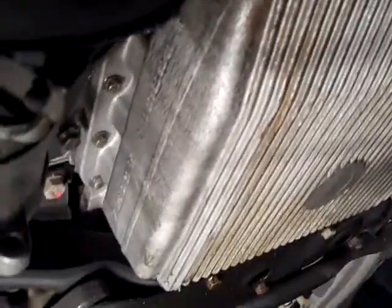So now we're going to go underneath the car. This is the front edge of the oil pan, and you've got an oil leak there. I really believe it is the front main seal — so good news there. Not really. That's bad news.